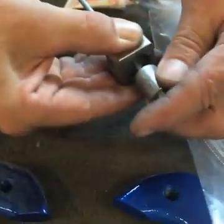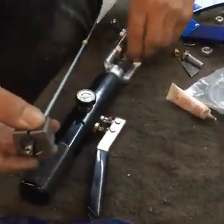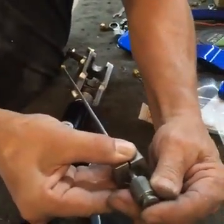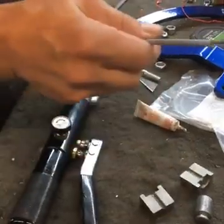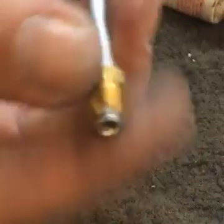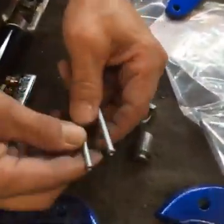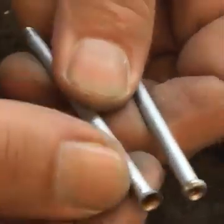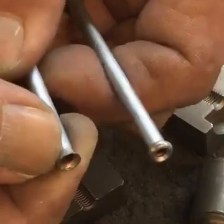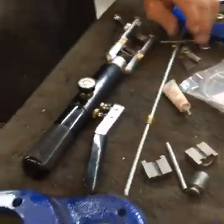You can kind of see it doesn't go all the way in. After that, you put your flat part of the flare, which is this. Put that in there to make it smooth on the inside. Take it out. And what will happen with this one, you can see how thin it is around the edge. It may seat, but it'll have a tendency to want to break around here. So that's how you do a double flare. Always use a double flare.